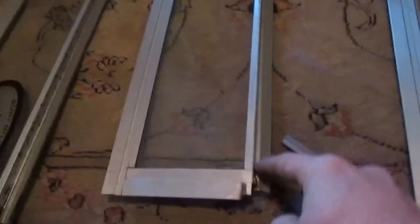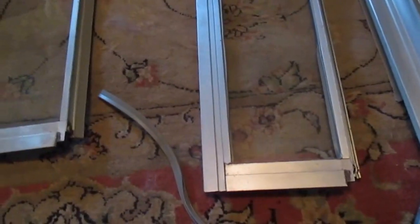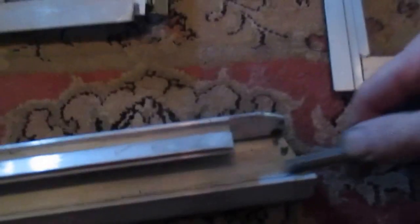Alright, so I've got all the pieces, they're all clean here, and I thought, you know, bring them in the house, put them together. I put this in this one here. This, I still have a couple little pieces sticking out. I'm going to work with them a little bit, and in the end, if I can't get everything done in, I may just razor blade them off. They're sealed. And I would recommend, if they look great, don't bother taking that glass apart. If they're not leaking and they look fine, just replace these pieces all the way around and the outer seal. Everything's been cleaned up. I still have to run this through the edges of each of these pieces, put these in the right places, and then I'm going to start reassembling.